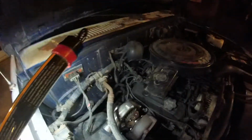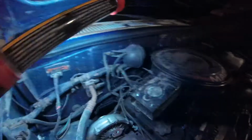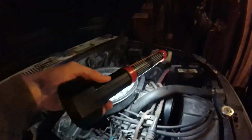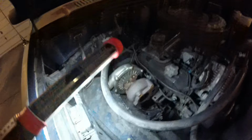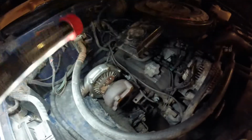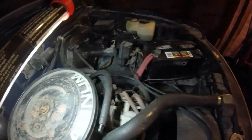What I'm going to do is take the factory Y pipe, and from here down to where they link up, I'm going to take the spot where it actually runs into the exhaust and just close that off. Then I'm going to run just a pipe from somewhere a little bit higher over and link the two halves of the header together, so that this header will go into the Y pipe and run up into and be pushed into this header. That way it's not exiting. Hopefully it's making a little bit of sense, but it's going to work basically like a Subaru Boxer exhaust, where the turbo will be mounted right here on this side of the exhaust, clear up front, and it'll just be a massive unequal length exhaust header, basically, or manifold running from here all the way over to this header.